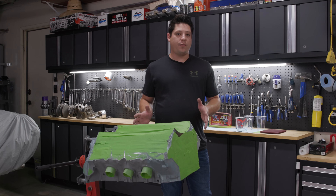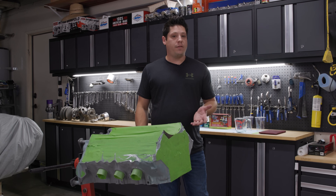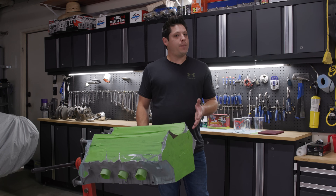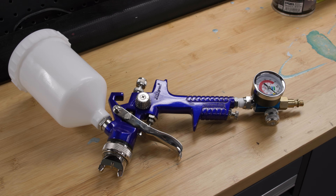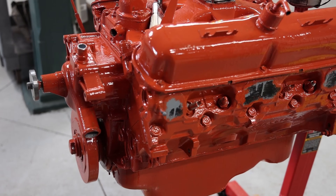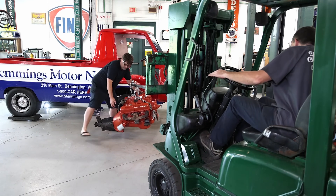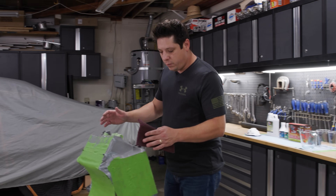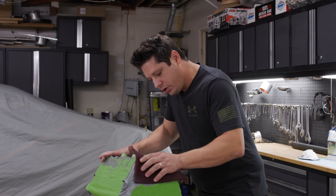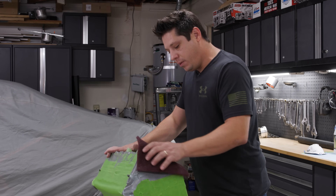The block is completely coated in rust preventative coating. While we originally planned to brush on the paint, after talking to POR15 we learned that some of their metallic-based coatings actually look a little better when sprayed, so we're going to use a spray gun. A lot of their other engine enamels — such as the solid colors like the hemi orange we used on our A100 project — brush on and look absolutely great. Since we let the rust preventative coating dry, we're going back with a magenta scuff pad to scuff it up a little and give us better adhesion for the top coat.